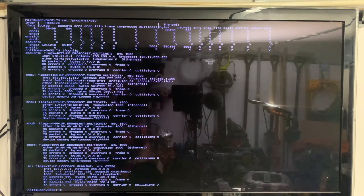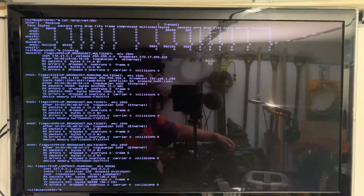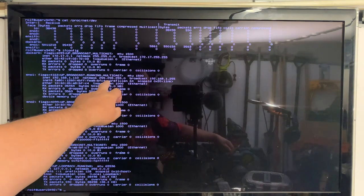See anything else of interest? Yeah, I'd like to mention that this is interesting, because anybody who's worked with networking on Linux will basically use ifconfig or something similar to list the configured network devices, and then will be surprised that there isn't anything that looks like our newly added network card. Because these are all like there's Docker, that's a fake one. Then you have the loopback, and then the actual motherboard on this server has 4 gigabit network ports, of which one is in use.